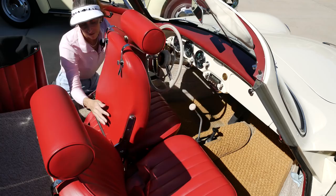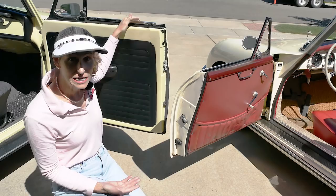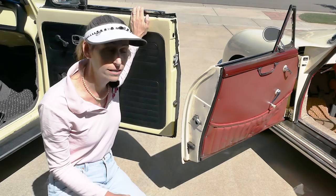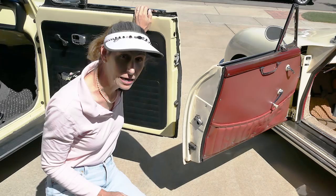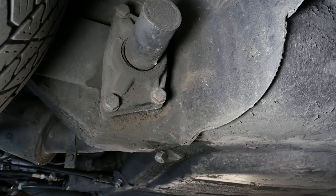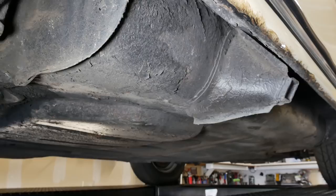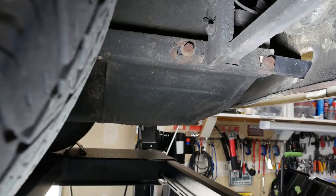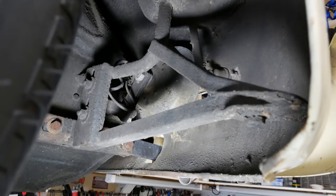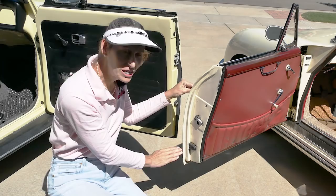A major difference between the two cars is how they're constructed. The Beetle door opens almost 90 degrees to help with ease of egress. The 356 only opens to about here, but the important thing is the thickness difference between these two doors — the 356 is quite a bit thicker than the Beetle. The 356 is built on a subframe: metal welded together into a small subframe with the running gear, engine mounted to it, and then the body laid over on top in different pieces and welded in place. Once it's in, it's in, and the rounded beautiful shape shows up in the doors.